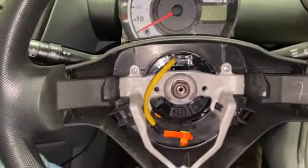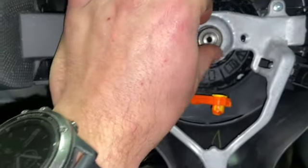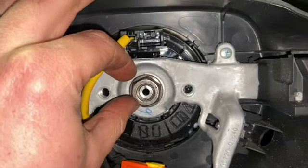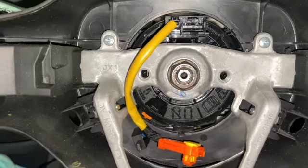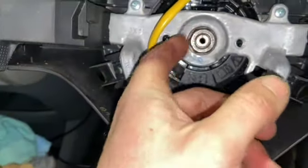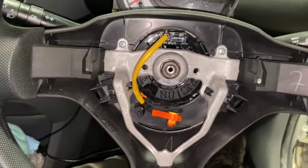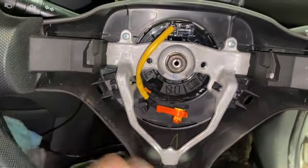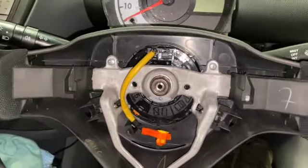At this stage now, I've just got back to putting the steering wheel back on. Obviously, I'm going to buzz the nut up just lightly with a buzz gun. But if you're doing it by ratchet, you don't have to be mega tight with it, just a good nip really. So I'm just going to give this a quick buzz up with the gun. Then we'll get the airbag on it, nip back up, and once the airbag's on, the connectors are on there, so it's safe to turn everything back on, just make sure everything's working again.